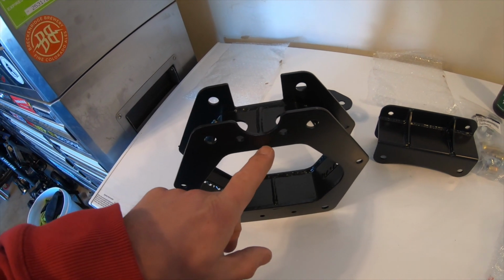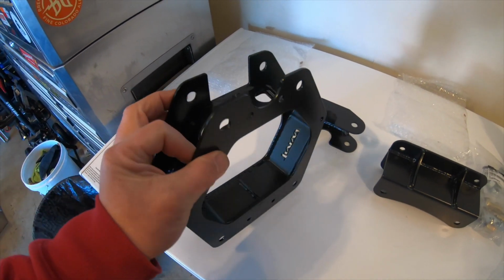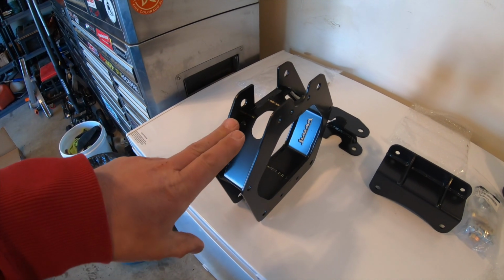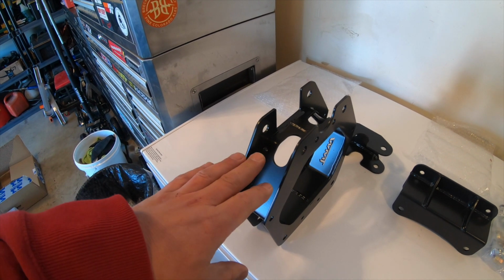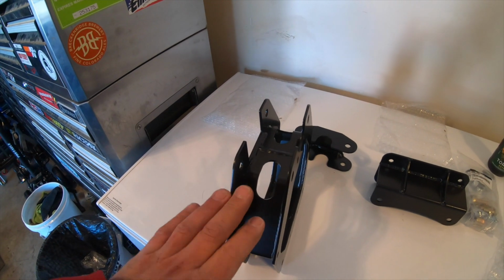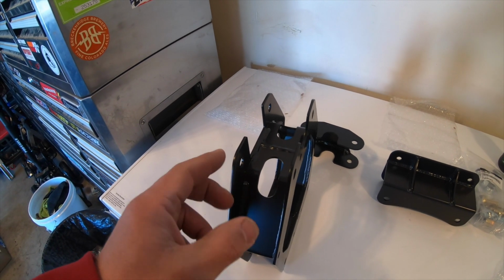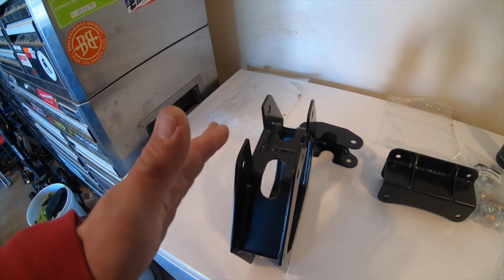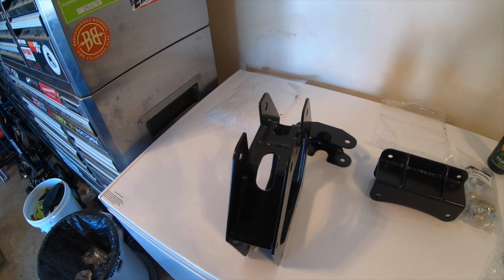Even the side plates are fitted in there before they weld them. So if you imagine, to give you a real quick idea, since you're watching, this will go on the front of that rectangle I was talking about, which is the tubular chassis. So it's kind of a rectangle that comes out. This sits on the front, and normally those upper arms just have a bolt that runs through here into that bulkhead, and unfortunately that doesn't give any support to the arms if they decide to flex, and it just makes that front end wallow out.